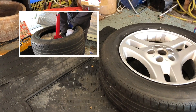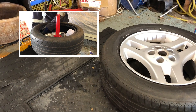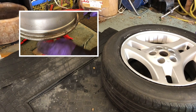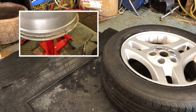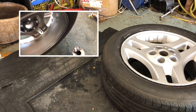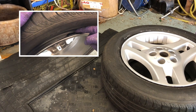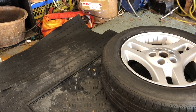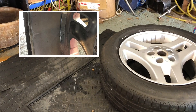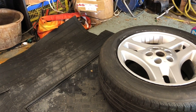A few tips discovered: use a piece of plastic clamped onto the tool end, and a separate piece of plastic between the alloy and the tire — that very much avoids damaging the alloy with the rough edge of the tool. When removing the last edge of the tire, prop the tire up into the small diameter recess — I used a roll of tissue paper — that eases getting off the last edge. Once the wheel is exposed, scrape, sand, and repaint the corroded areas. It's quite useful having some white spirit to clean off the previous bead sealer. Use bead sealer to get a good seal if you've still got rough edges. Use soapy water as a lubricant when assembling but clean off the water so you don't leave any inside the wheel, which can lead to corrosion. And if balancing yourself, don't use tap-on weights — use stick-on ones instead, as tap-on weights damage the paint, leading to alloy corrosion and eventually leaks.